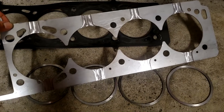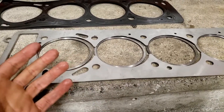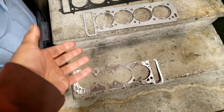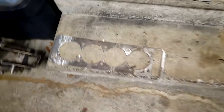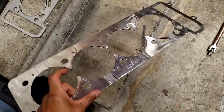I'm not the first person to do this. If you do some Google searches on this kind of stuff you might find some information — Le Mans cars do it this way, as do other forms of racing. Nobody really talks about it. It's fortunate that I had this thing apart because I just straight up took the gasket off the race car. This doesn't require any machining or resurfacing because it's actually all sealed with sealant around the coolant jackets. So the deck surface condition doesn't really matter as long as it's clean — which is fortunate because I can get this done before the sun comes up tomorrow.